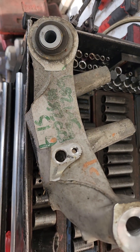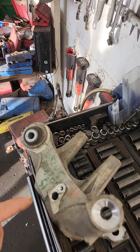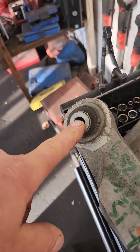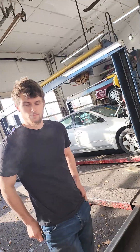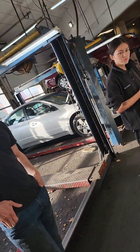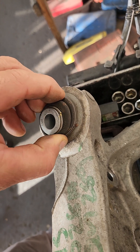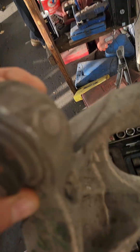If you see this on your vehicle after repairs, it typically means junkyard parts, salvaged parts, used parts. And I'm going to tell you this for sure: spherical heim joints for daily drivers is not a better design. It has a rubber boot and a steel collar — it's almost like a ball and socket joint but not exactly. Non-serviceable.